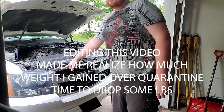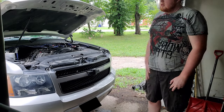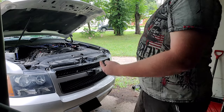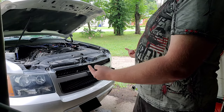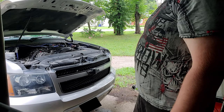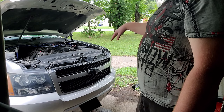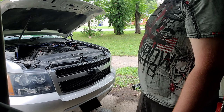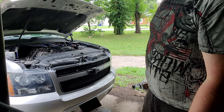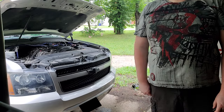The way you take these off is there are two 10-millimeter bolts right here and two more right here. If you want to take the whole bumper off there are two more, plus two more 10-millimeters underneath. But from the videos I've seen, you should be able to do the four up top and then reach back and pop it right out — keyword 'should,' because it doesn't always work that way. Most likely you'll see this with the bumper off.